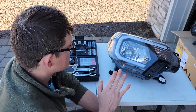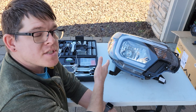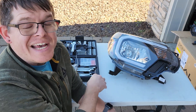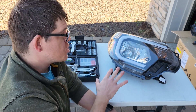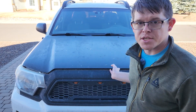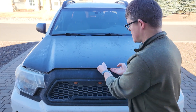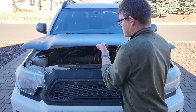To get started, the first thing I did was unwrap my headlights out of the packaging. It's important to inspect your headlights to make sure that all of the mounting points are still attached and that you don't have a potentially defective or damaged product — there's no point in going through all of this work just to have to take it off again to send it back. First step for any work under the hood: open the hood. Typically you have a latch inside that you pull which releases the first step. Once you have that, there's a little latch here that opens it the rest of the way. It comes up and you want to prop the hood up, making sure it's stable.